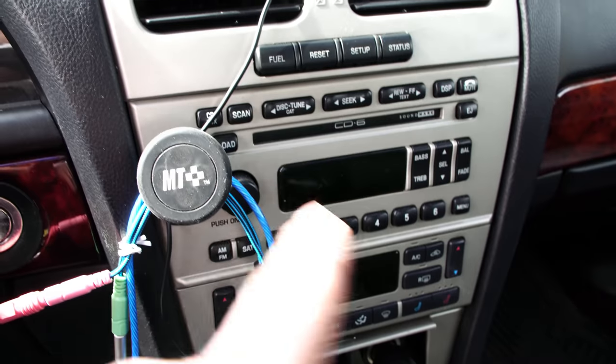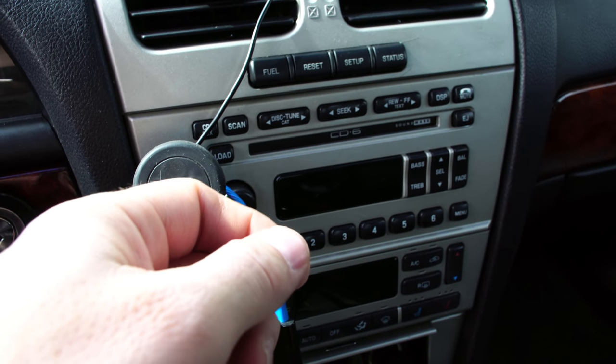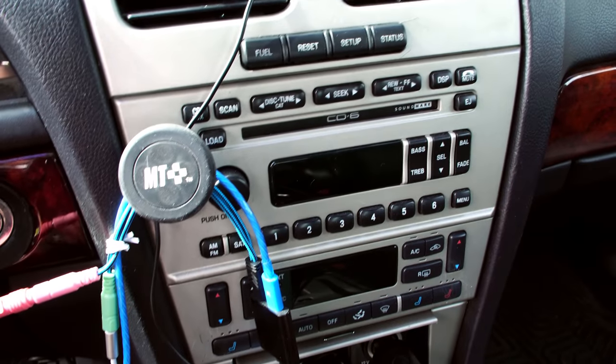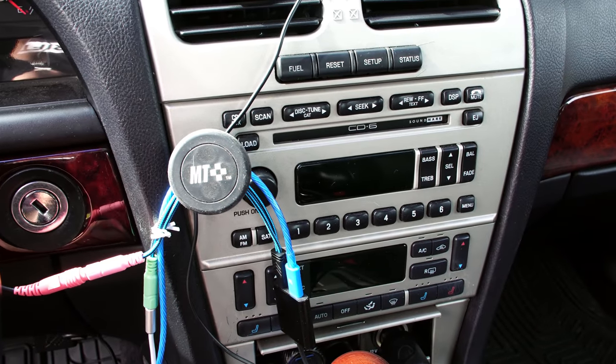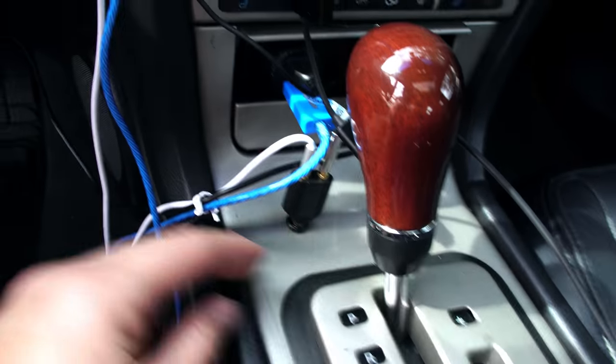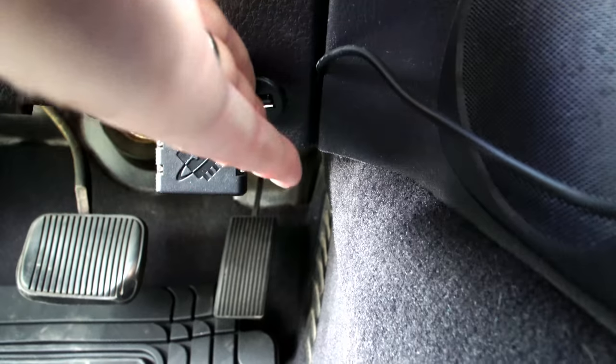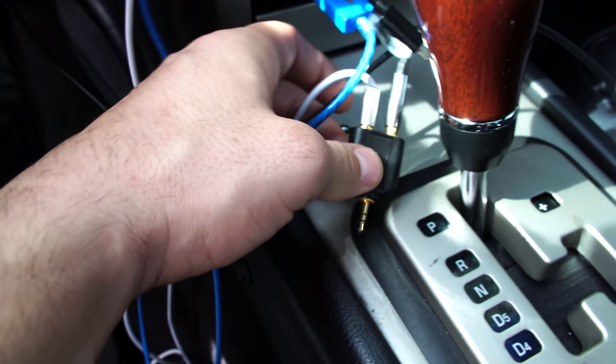This right here is an audio splitter for both the PC green line audio out and then the microphone. This is actually the same microphone I'll be repurposing to use with the new audio setup, the new head unit. You see this little split, and then this audio cable goes down and back up. The previous owner had installed an auxiliary jack here with a little power switch that activates it. There's some interesting stuff going on behind the scenes — this actually powers on a radio transmitter that's behind the unit and broadcasts over like 89.7 FM. But the issue is there's an area in Fort Worth downtown where there's interference from that, so I get static every time I'm downtown. This auxiliary jack and USB-powered outlet were both wired into that power source by a previous owner.